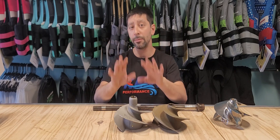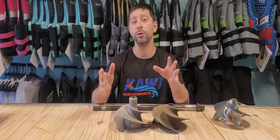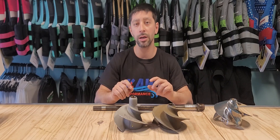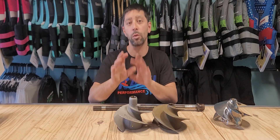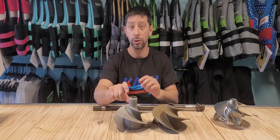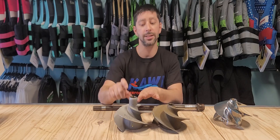Glenn at Improse can re-pitch the stock impeller to whatever you want — we recommend stock. You can move it up to like a 1421, but the best impeller for your 310 is the stock one because of the long nose. And you can see the pitch is exactly the same as the 300 — it's the long nose that makes the difference.